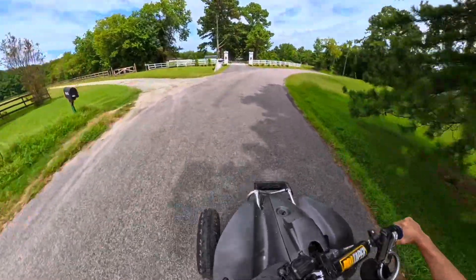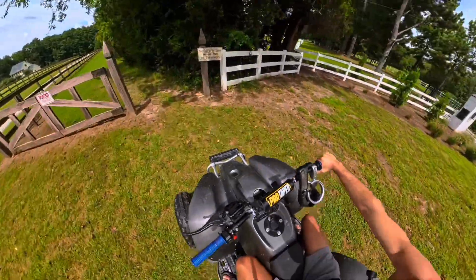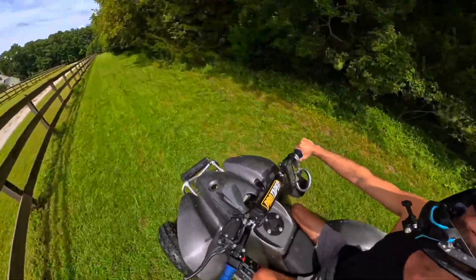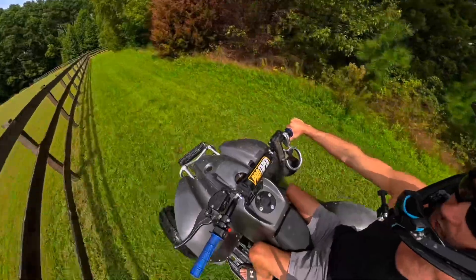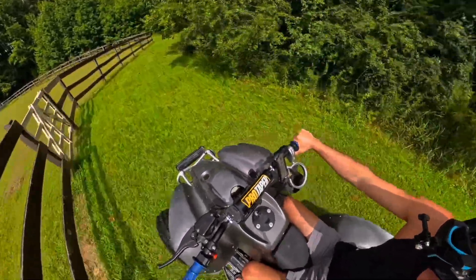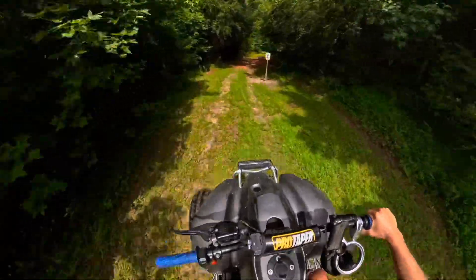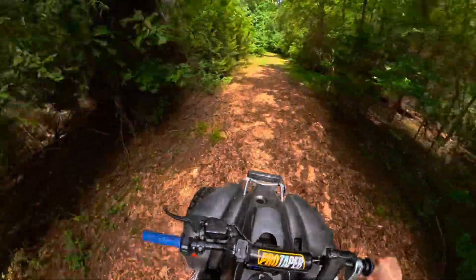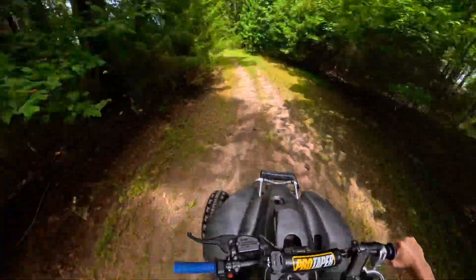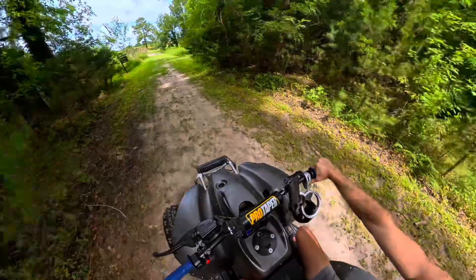On the other hand, spending just slightly more money, you can get the ANT BMS. I have not seen a single ANT BMS failure yet, and I've built probably 20 to 25 battery packs with ANT BMS — never seen one fail. For the small size category, like my mini-cart or a Sur-Ron battery, I recommend either Hot Packs, which sells packs for Razor MX650 dirt bike builds around 30 amp-hours and 72 volts. As far as I know, they do not sell any 76-volt 21S packs, which can be a drawback because everything I do is 21S. I don't do 20S anymore.